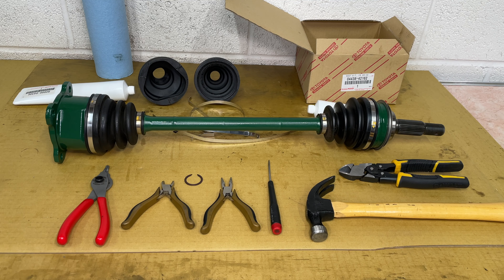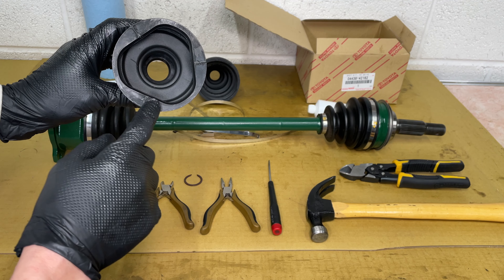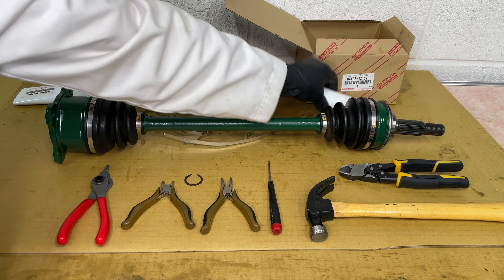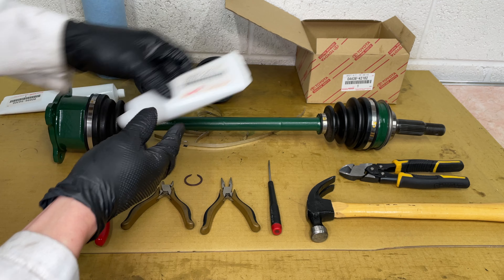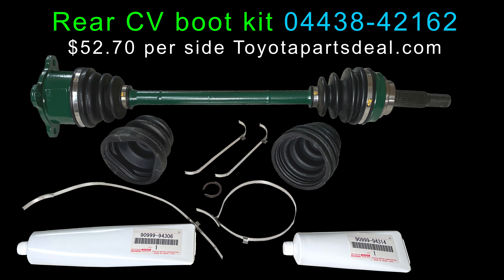I'll start by rebuilding the rear CV axles. You know you have the right kit because the inner CV boots have a flat thing going across. Here I have a bunch of new bands. The inner CV boot gets a larger tube of grease than the outer CV boot — make sure you have plenty of paper towels, that's a very dirty job. The boot kits are still available from Toyota. They're less expensive than buying low-quality replacement axles, and these Toyota axles don't actually wear out as long as the old boots haven't completely torn. If your old axles are loose, the grease came out or dirt got in — find some better axles at the junkyard and rebuild those instead.